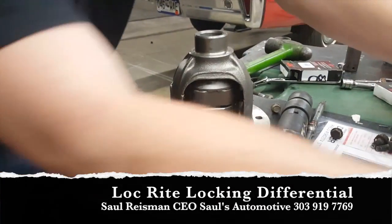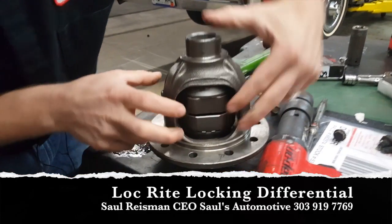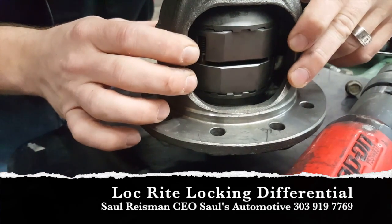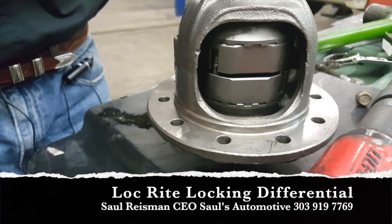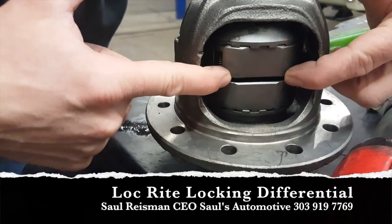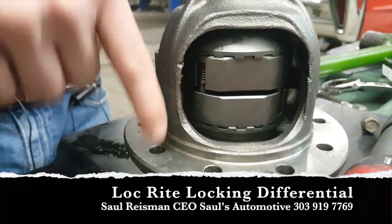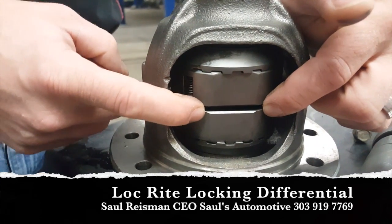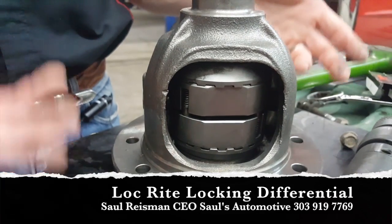Inside this rotating carrier that the ring gear bolts to, we've actually installed a small device that's a spring-loaded, quad clutch pack driven pin. And what this will do is, instead of letting these two outer gears rotate in opposite directions freely to let torque differentiate on its own, these two clutch packs, which are being forced apart with almost 1,000 pounds of force, will act as a spring clutch, and in the event of power being distributed into them, will distribute power both directions by forcing these gears apart. However, because there's a spring in here, in the event of a tremendous amount of load being applied to it, these springs will give in and let it still ratchet or differentiate as it should.